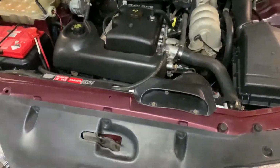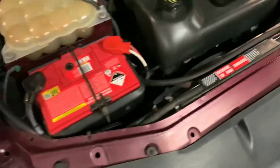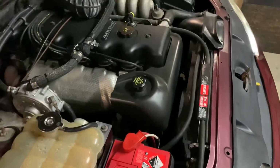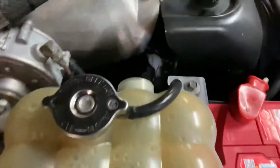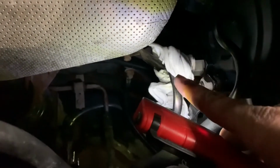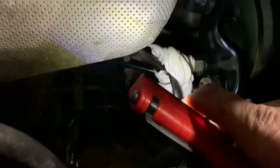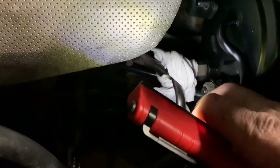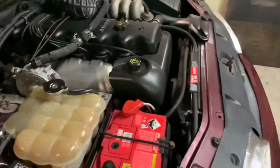Righto, so I got it back in the shed now. It's all put back together. So radiator's all in, fan shrouds in. Now, we got the new power steer pump on, but as you can see, this is that line right there. I've got it ragged up at the moment. That's the high pressure power steer line. They have a nylon bush on the inside of them, and it's failed, so it's leaking. So I've just got it wrapped up so it's not going to leak oil everywhere. So I've had to order a new high pressure power steer line for it. So it's not one thing, it's another.